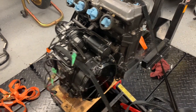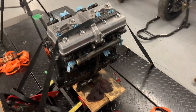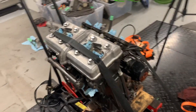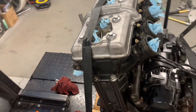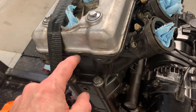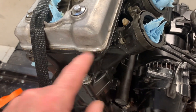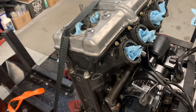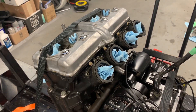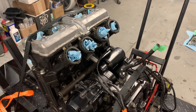This is just the initial cleaning, not final cleaning. What I'm going to do to clean that valve cover is take it right off, because I think it would be smart to just reseal it — it's weeping a little bit. I could tell from the residue of oil that was wicking around the edges. I'll take the valve cover off and maybe do a valve clearance check too while I'm in here.